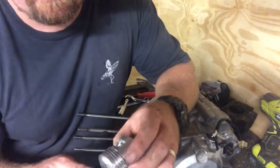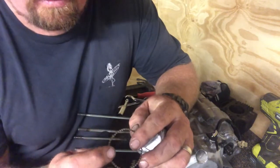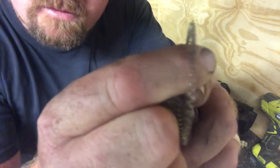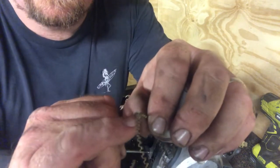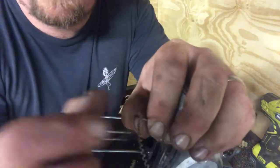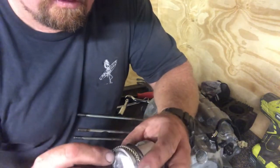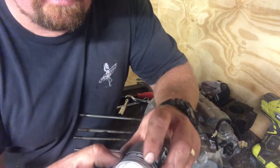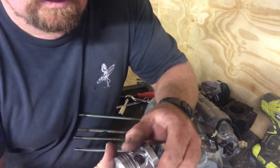We're going to put the rings on. This oil ring — on the inside of it, it's wider and there's a step down, so it actually sits in behind those thinner rings top and bottom. This goes in first and then those thinner ones come in afterwards top and bottom, and they sort of help hold this in. So just before I put it on, I put the bottom thin ring in first — just seated it down nicely — then slide the oil ring up.